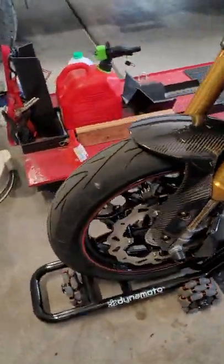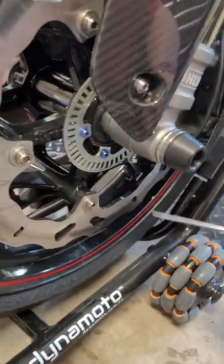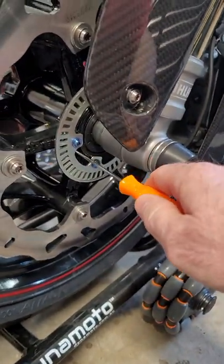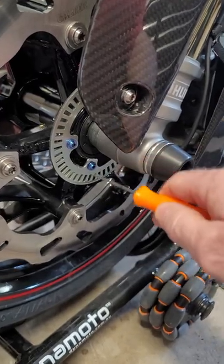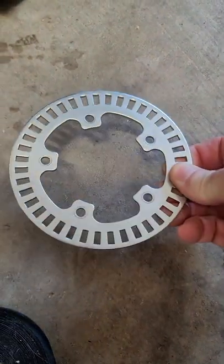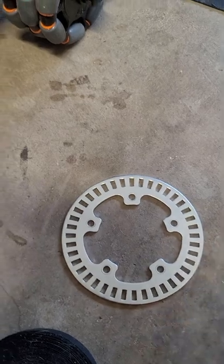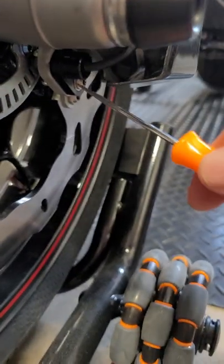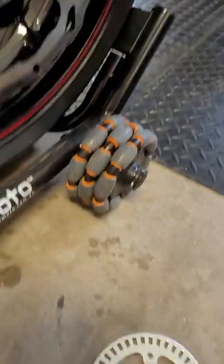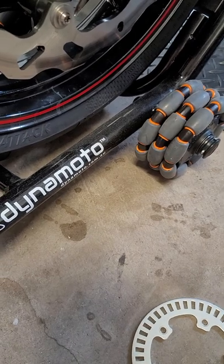The front, however, is where things start to get a little interesting. The 2022 wheel looks exactly the same as the 2019, but the difference is it does not have mounting points to accommodate the front tone ring. A tone ring is a simple piece of metal that has slots, and these slots, when the wheel is spinning, correspond with a sensor that's mounted down underneath your forks. That sends a signal to the computer that your ABS, traction control, and speedometer needs.